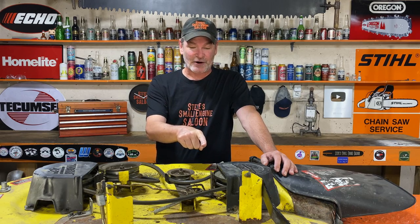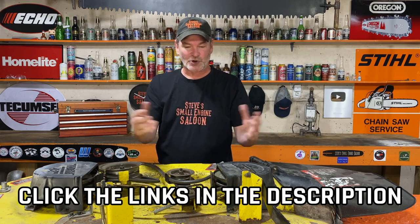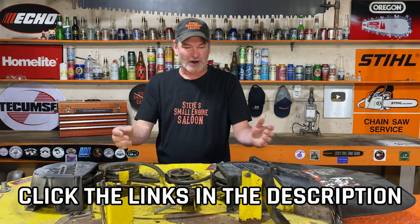Those brakes are there for a safety reason and they have to be kept good. By the way, if you do see that on your rider one day, I have a link underneath in the description where you can buy new ones — they're actually not very expensive, just not that fun to replace. Save your blade brakes by idling your engine right down before you disengage the blades. I'm going to say you'll probably get 50% more life out of those brake pads if you do what I just told you.